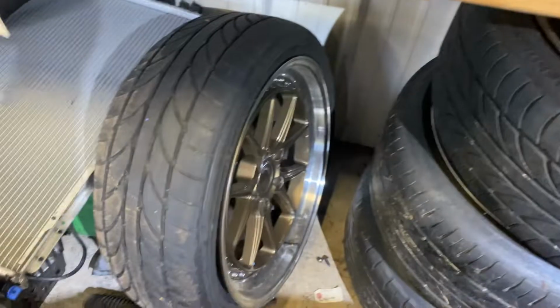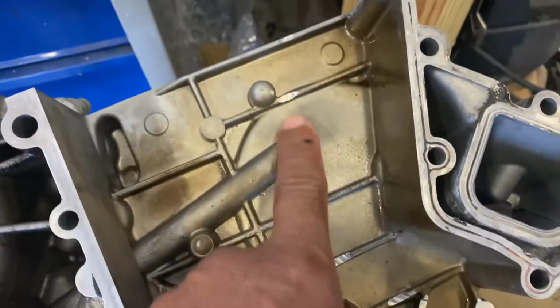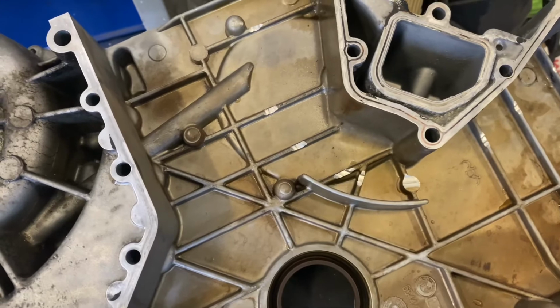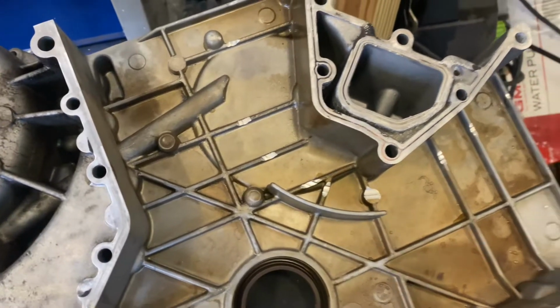However, we didn't hear any sign of the chain hitting the cover, but after we pull the cover off, this is what we see here. So we know the chain's definitely hitting the cover. That seems to tell us that the U-shaped rail is bad, or the U-shaped guide is bad, and maybe the tension will have a little say-so in it.